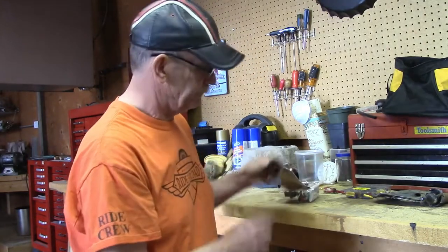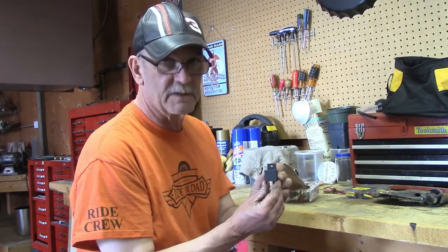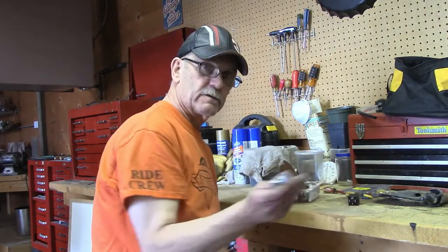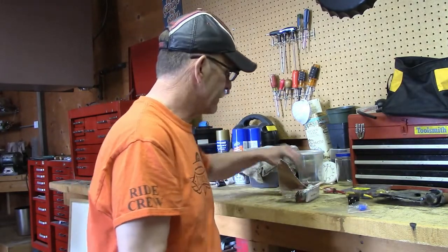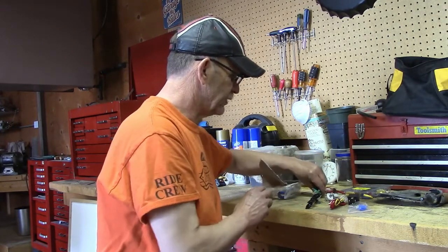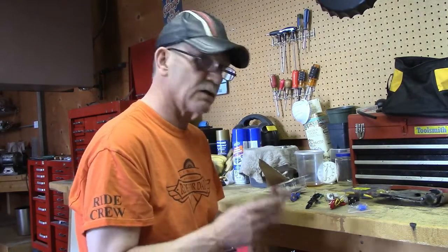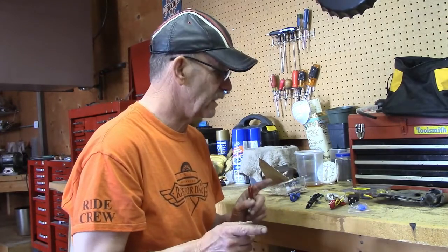So the important stuff. This one comes with a 40 amp relay, so it's way more than enough to run the fuel pump. As a matter of fact, we'll be putting an inline fuse in. It comes with all the connection screws and accessories, a switch that we won't be using, so we'll set it aside. Plus it comes with a nice set of pre-crimped connections and wires to make it all work. In addition, I purchased an extra fuse holder because I want to have a fuse in the line that actuates the relay and a line in to the actual run to the pump.